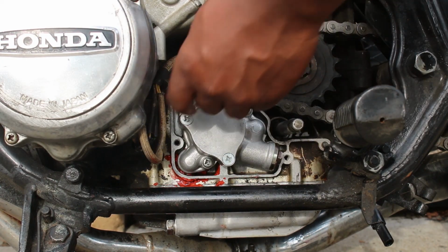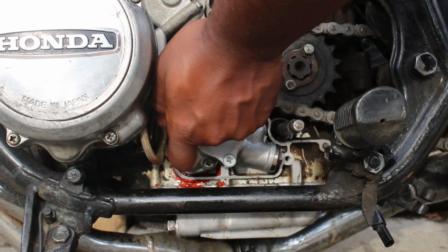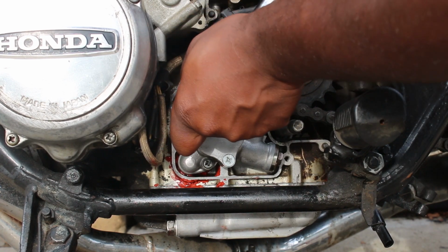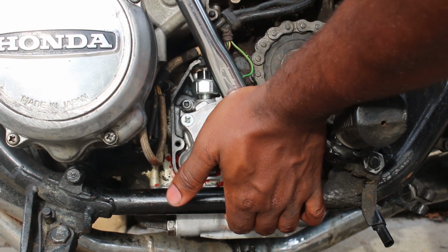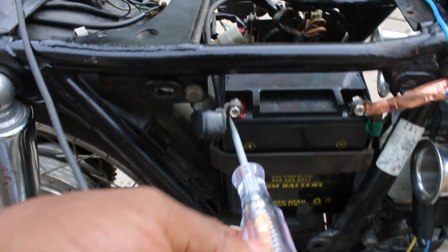I actually used this stuff on the K100 oil pump with success. And just for your information, there's actually no gasket for this mating surface for some reason. And finally, I very carefully torqued all bolts to spec evenly. Now, of course, when you're dealing with anything with the oil system, you gotta rig up your makeshift oil pressure light just to make sure everything's working.